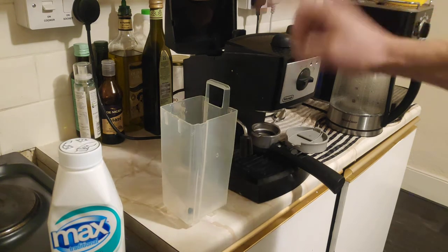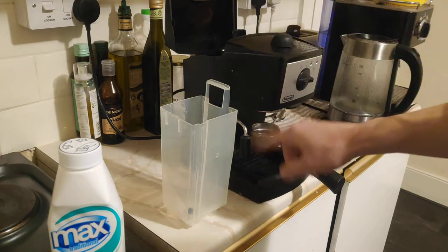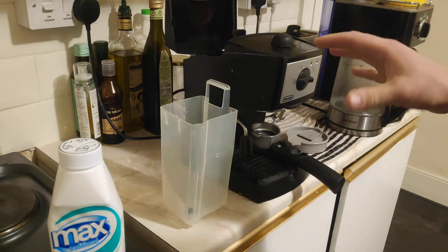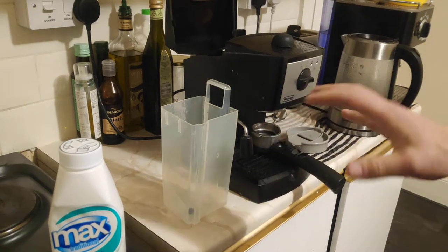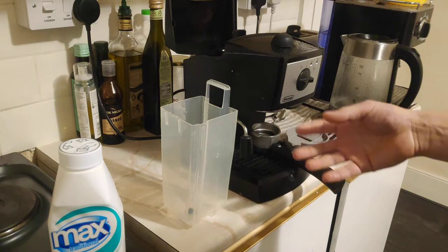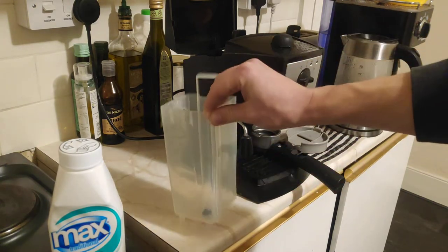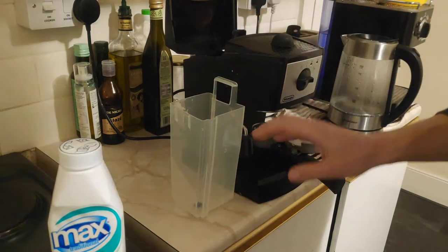But if you put 4 tablespoons and you try to descale it with a lot of scale on the inside, it will clog up. So, you know, do your math. If it's very, very contaminated, maybe 2 tablespoons, and then go with the water through it and then try with 4 tablespoons, like 2 liters. I think that's a liter of water it takes. So for this one we'll use 2 tablespoons for 1 liter of water.